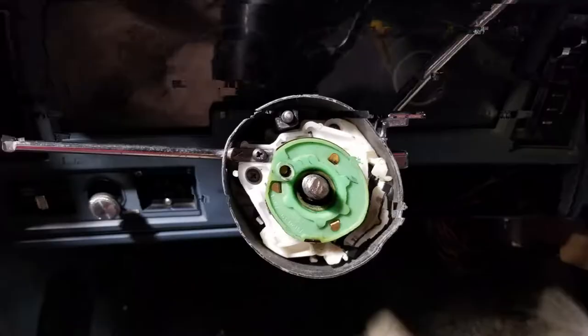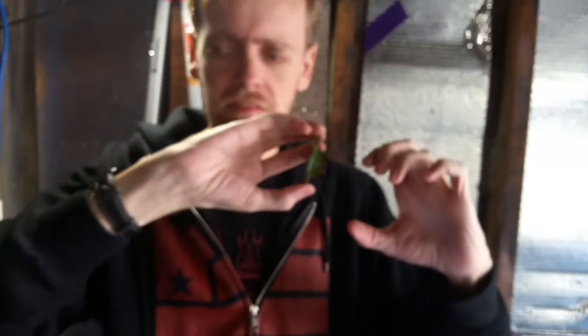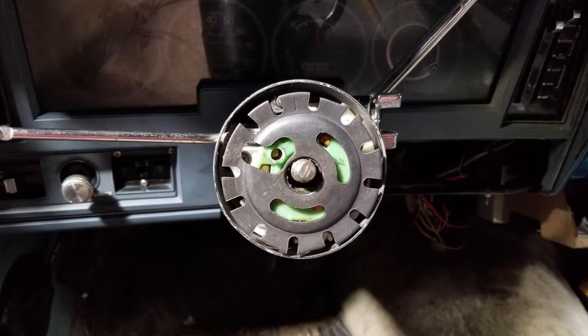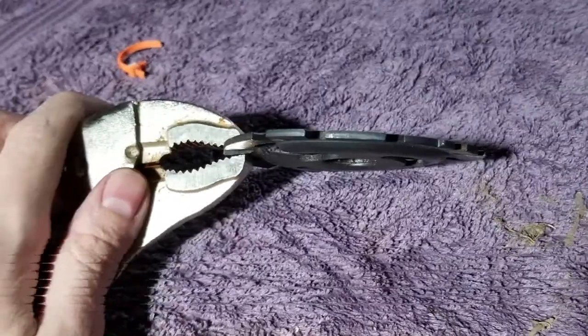In order to do any of that you have to have all this stuff off. So the spring goes in first, and this green thingy goes in — what it actually does is catch and hit the turn signal switch when you're turning. Say you turn the right turn signal on and then you turn right, it goes click and undoes it. Then behind that goes this thing. And this metal plate you've got to compress in a really awkward way. I couldn't get it to go down, got it all bent out of shape, and had to straighten it out with vice grips. Because I was doing it wrong.